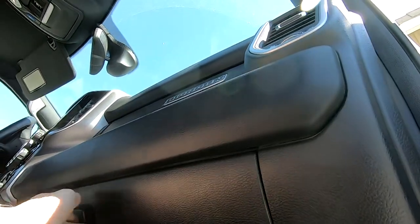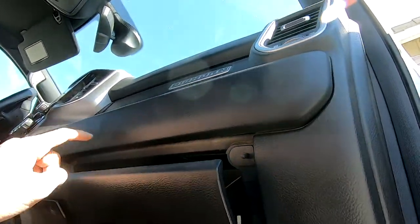To get the glove box back on, we want to snap on the three lower hinges, lining everything up, and opening and closing so they fall right in. I didn't have to use force to snap these hinges in. Open and close a few times to make sure things are smooth, then push all the way to snap in the left and right pins behind the stopping tab.